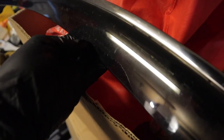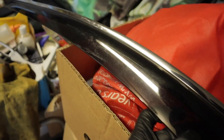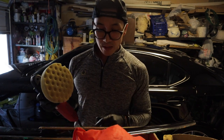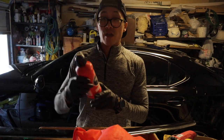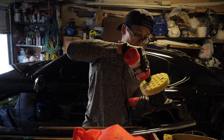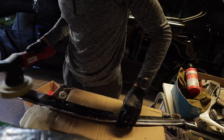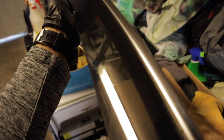As you can see there's a lot of scratches and stuff on the plastic and the chrome trim — let's see if I can get rid of most of those. I've got a foam pad on my DA and I'm just gonna give it a quick couple passes, because I don't feel like doing it by hand. After a pass, it didn't do too much — I think it's because the pad is too light, I might need a heavier cutting pad. The only thing it did was kind of just make it more shiny.